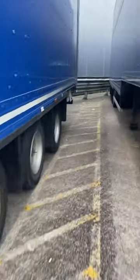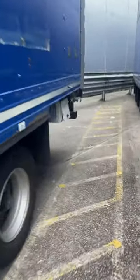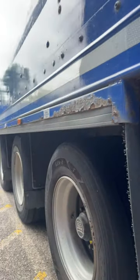So rather than doing a slow wind on the legs, walk down to the back of the trailer and dump the air that's in the trailer, and that will slowly lift the front end of the trailer up just enough for you to be able to get underneath.